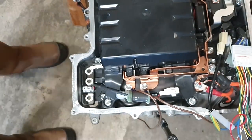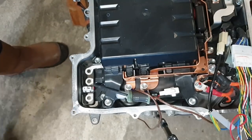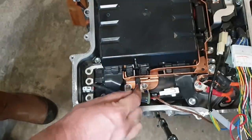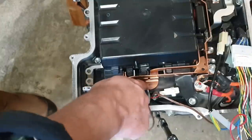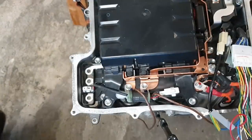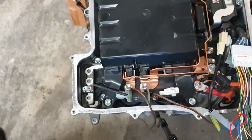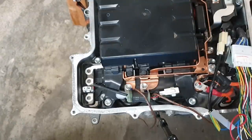Alrighty, so the inside copper bus bar here, this guy, is our HV positive, and the outer one here is our HV negative. And I've got just two big pieces of 2.5 millimeter squared wire attached to these two bolt terminals here, and I've got myself a little high voltage control setup that I'm going to show you now, and it's the way that I would strongly recommend that people proceed when they want to do particularly initial testing, and particularly when they may not be familiar with how these things can go wrong and so forth.